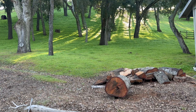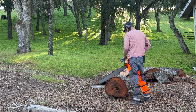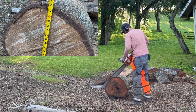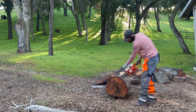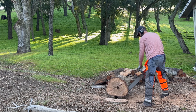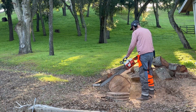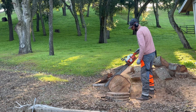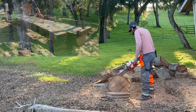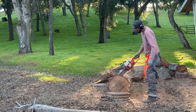Here I'm cutting through seasoned live oak, which is a species of red oak and one of the tougher woods for cutting firewood on the California central coast. At about 20 inches diameter and being dry, it's definitely giving this little saw a workout. Nonetheless, it's making good chips and good progress with just the bar weight. Cuts were remarkably consistent at 1 minute 40 seconds each. These tests are at the upper limit of what I'll actually use the saw for. I'm calling this combo of a long bar on a light power head with a little power bump a success for my intended use. For big stuff I can get out the 395 XP, but for limbing and bucking smaller freshly fallen trees, this 55 will be my go-to.